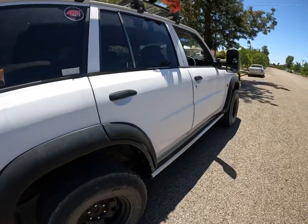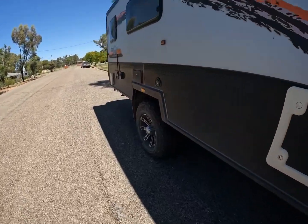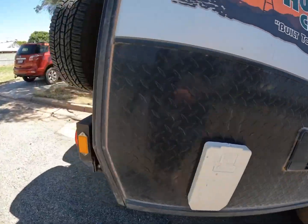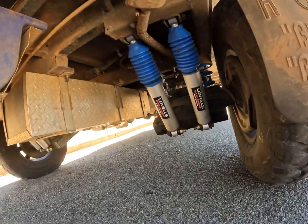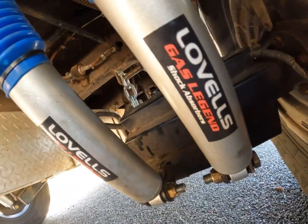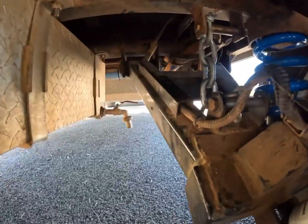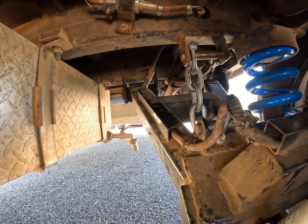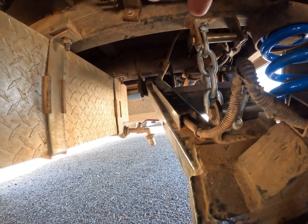Well, I'm back. Just got out of the car, haven't even gone inside yet. So here we are. Before I tell you what I think, I'll give you a quick look at what's been done under here. New shocks from the Lovells kit, as you can see. New spring. And the new chain there that took out the strap - the nylon strap - and put in the chain. It also has had new bushes put in up there at the top of the swing arm.